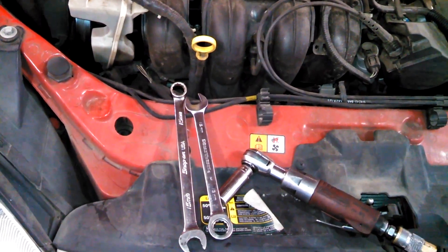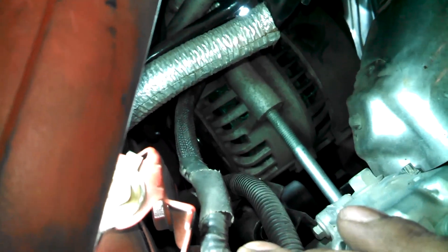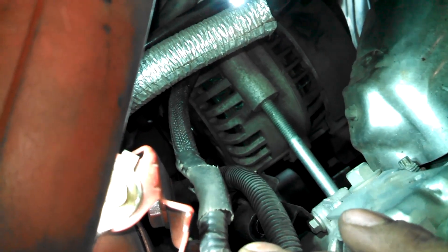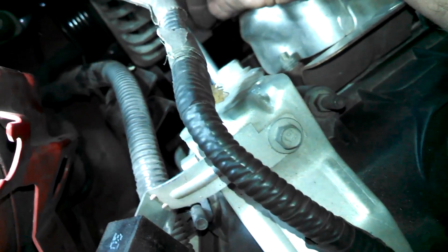I've been using an air ratchet — use a ratchet with a 15 millimeter socket or hand tools, those will probably all work. You may notice that the alternator does not come off the studs. The Ford information says that if necessary, remove the studs. I do believe it's going to be necessary — it may have to do with the air conditioning back here, which seems to be interfering, along with the fuel line. So you can use a vise grip and get it on there and turn it — maybe it'll turn by hand once you loosen it up.